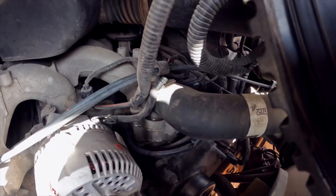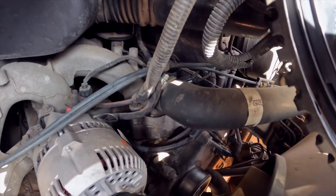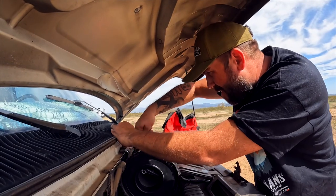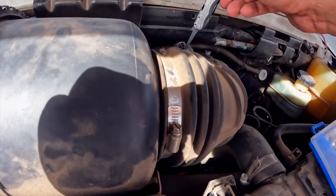I don't know exactly what's causing that - whether it's a hose issue, a thermostat issue, or a gasket issue. Not entirely sure, but I have to look into this further. It could be a leaking o-ring. It also could be the thermostat as well. So we're going to go ahead with this thermostat replacement and hope that that's a fix, but it could be something worse. We'll have a look.